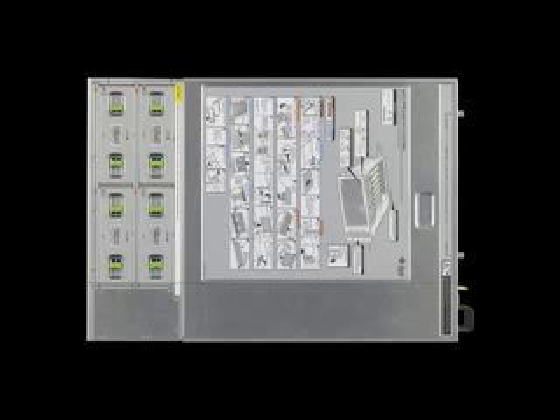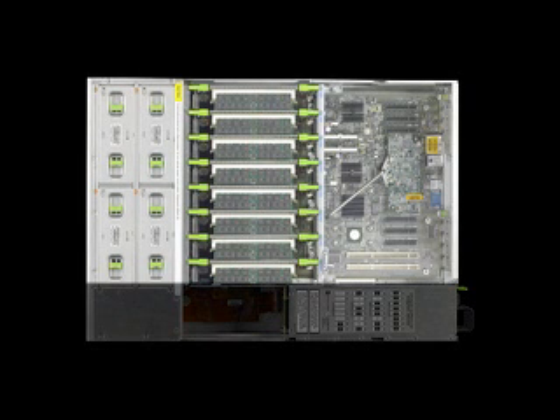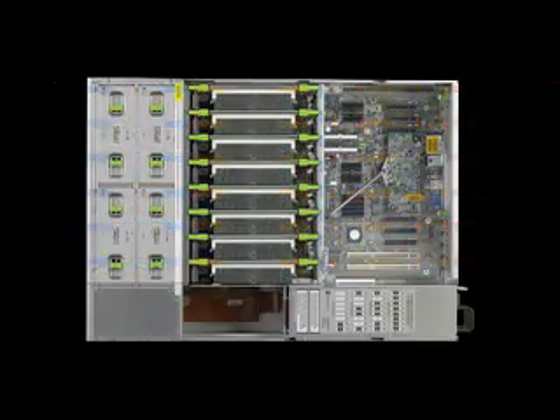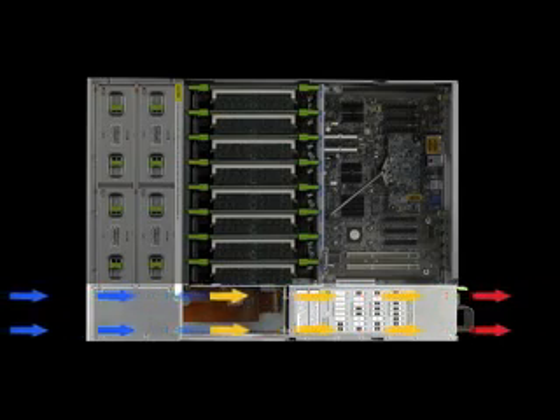The chassis of the Sunfire X4600 server is divided into two distinct cooling zones. The first cooling zone has the greatest airflow to cool the high-performance CPUs, memory, and I/O sections and is driven by the main cooling fans, while the second area, containing the hard drive and power supply units, is cooled most efficiently by the fans included in the power supplies. Both sections of the server are cooled by air drawn in from the front and expelled from the rear. Cooler systems are more reliable and power efficient.